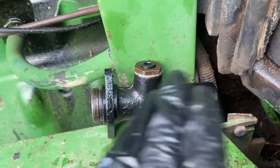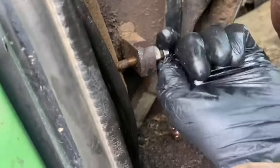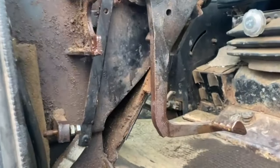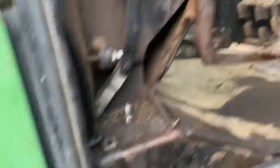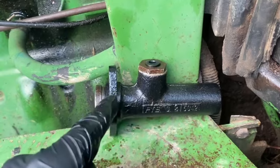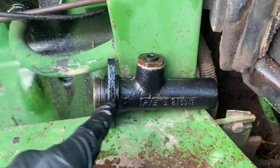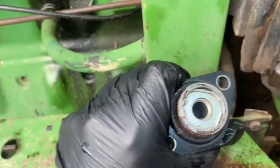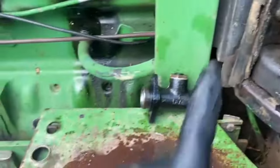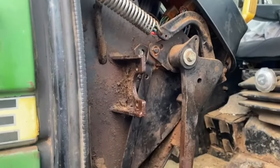It can never really create air, but the problem comes if you push the clutch too far. This bolt determines your depth — how far you push the clutch down. If you push the piston down too far, the seal gets scratched by the two little holes, then it goes past and you'll see oil popping out inside the rubber. I'll take that off in a second, put it on the new one, and then start fitting it back up and bleeding it.